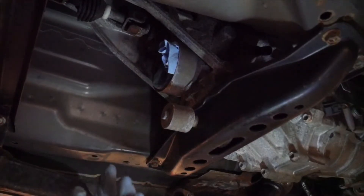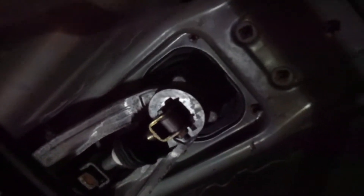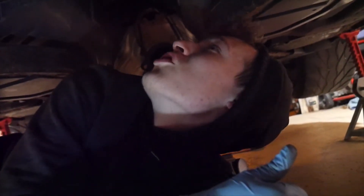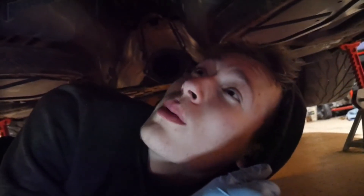Now what we have left to do: there's some stuff up here for the shifter bracket to disconnect, and then we've got these two mounts. After that, it's literally just the bolts that hold it to the engine. I already took the slave off — you can see it dangling there, just two 12mm bolts that hold it to the transmission. The new trans didn't come with a slave, and I'm not going to take that banjo bolt off so I don't have to bleed the clutch again. I'll disconnect some of the shifter stuff up here — it's just a couple bolts for the rubber boot, pretty self-explanatory. Then I'll deal with the front engine bolts before doing these mounts.